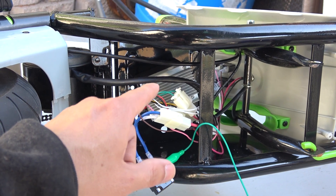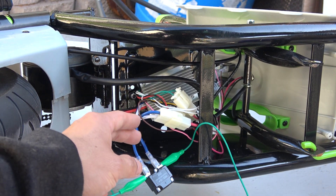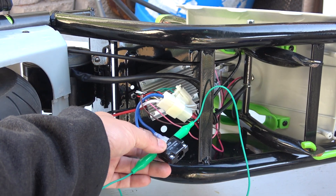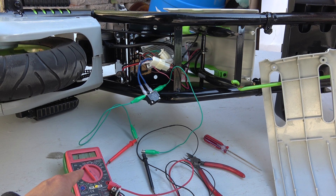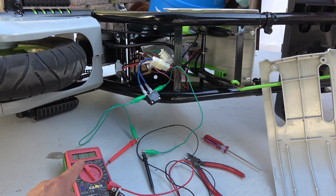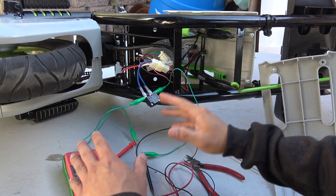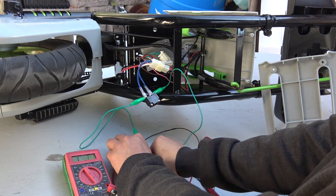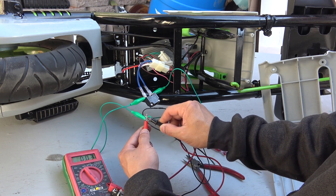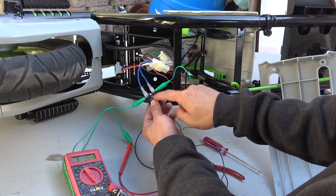Here is the bottom of the cart, and that's the fuse. Before the power goes to the motor, it goes through this fuse here. I'm using my meter to test the continuity of the fuse, and it's nothing — so this fuse is blown. This is the easiest way to test the fuse: that's continuous, that's discontinuous. So this is dead.